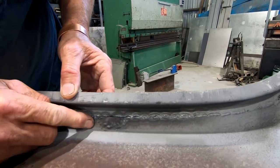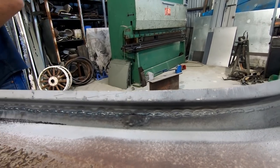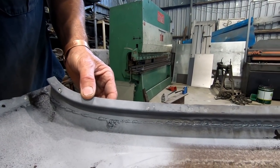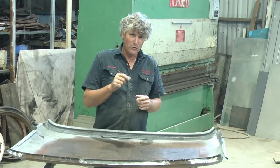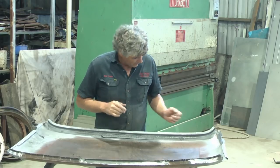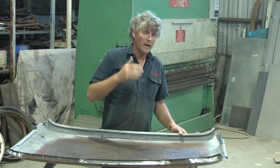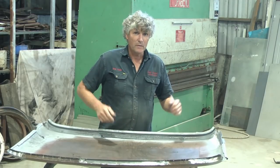So it's this area in here, and you can just see where they've built it up with weld, and the same on the other side. And just sat there and kept welding and welding until the piece of rust was filled in with weld. If you've got a tiny little patch and you've got to do two or three passes side by side, that's acceptable. But if you start walking up, and you look at this one, there's an inch and a quarter or so of steel that they've actually had to build that spot all the way up from the bottom. In those situations, you're better off to just cut your losses and cut the piece of steel out and weld